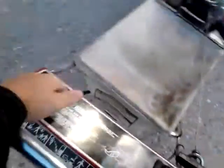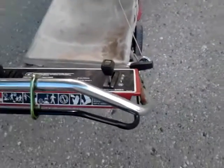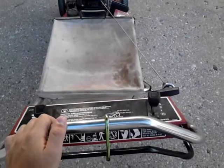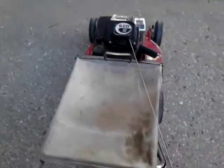I know during the summer, usually I can just leave it down at idle. You can see: choke, fast, idle. Normally I'll leave it at idle, give it one pull, and it'll start up. But it's kind of colder out today — probably in the 50s. So let's see if I can do this one-handed; see if it'll start at idle or if it'll need choke.